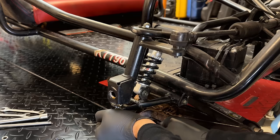And this is what I'm talking about on the old panel. We have these two welded nuts right there. On the new one, we have spots for them, but they're empty. And those are actually for two different purposes. This one is an extra support for the airbox, which I'm not sure if this airbox can take advantage of. We'll take a look when putting it back together. And more importantly, this is for clamping down on the cable. So once it's connected to the go-kart, we'll be able to control it with the pedal in the cart rather than this lever.